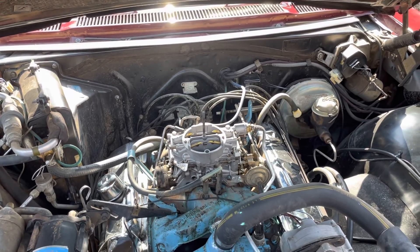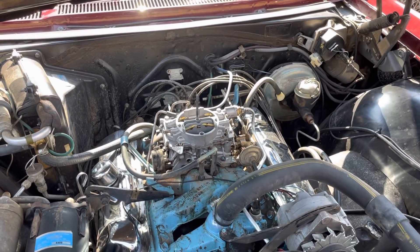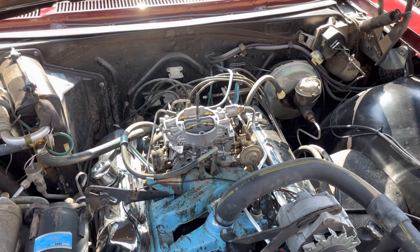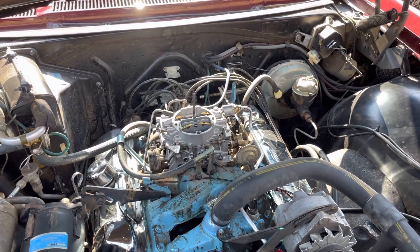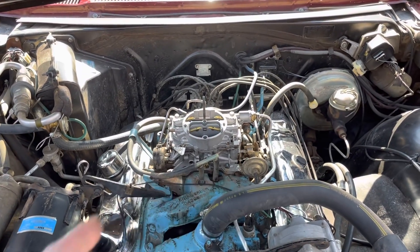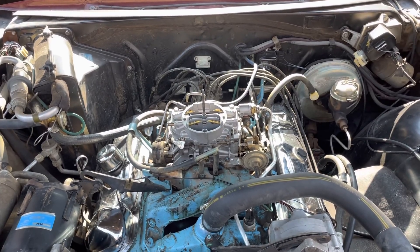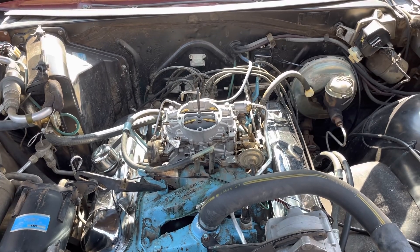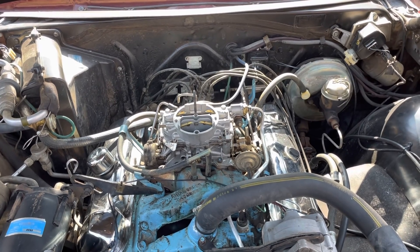It has instant throttle response. I need to get some racing gas to put in here too. On these cars I run premium plus lead additive — I use Motor Medic lead additive, I just get it on Amazon, a big case of it. And then I use about four or five gallons of racing fuel. I'd love to be able to use ethanol-free, but I don't have a station close to me that has it at high enough octane for a car like this. So I'm forced to use 93 pump gas, and yes it just means I'm rebuilding carburetors and needles and seats more often.